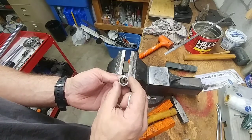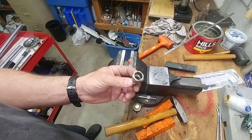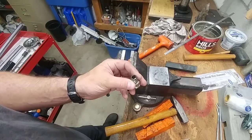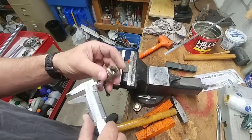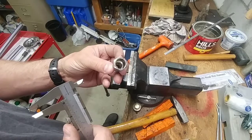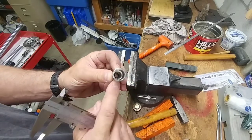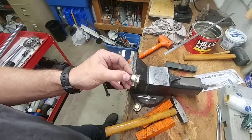I'm going to try to thread this, but I just realized — a 12mm spark plug, you would have to drill. So what is 12 times 0.8? That's 9.6. So for a 12mm tap you need a 9.6mm drill. This is 8.5 but up here it's way too big, so in the upper section I can't tap 12mm. I might have to shorten this — cut it off to leave just a little bit of a shoulder so the spark plug thread can actually seal.